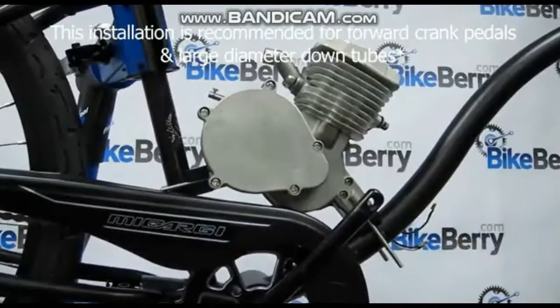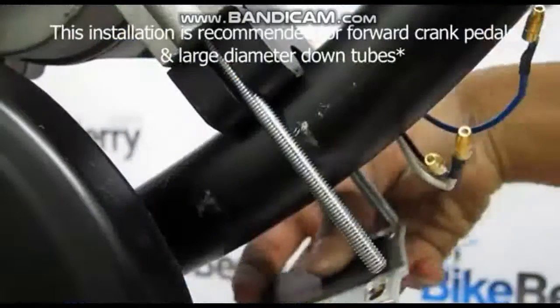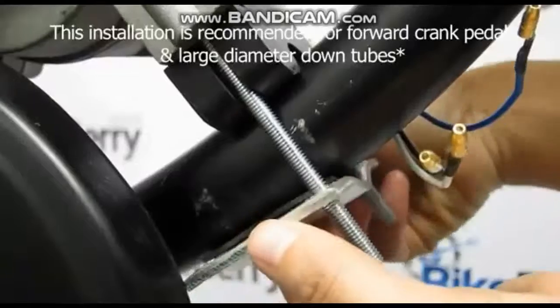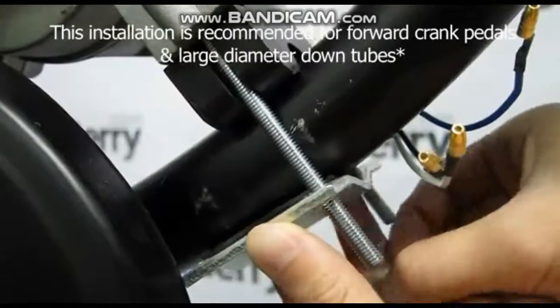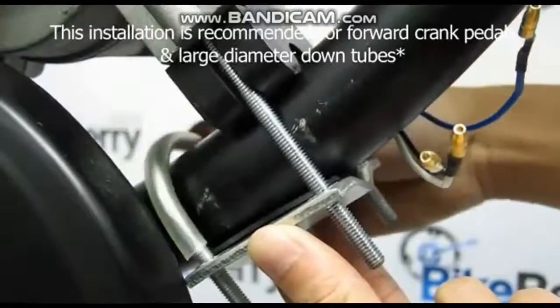For this bike, we are encountering both issues. So to solve it: install the J&M vibration motor mount, position it on the bike the way you want it mounted, and then take the HDU mount, remove one of the two U brackets, and install it on the bike. Then thread the rubber mounts and you're done.